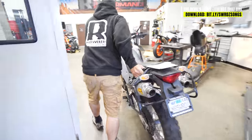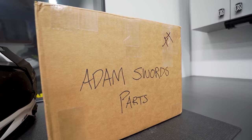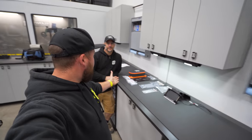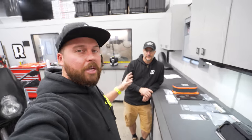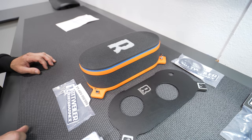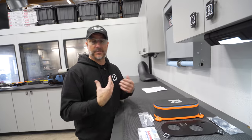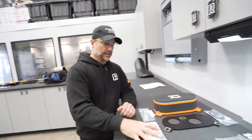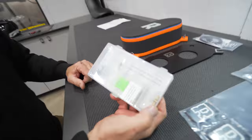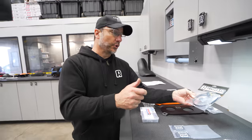It is time — we have all the stuff laid out right here that is going to go onto the bike. Chris is going to run through this to tell you exactly what it is, what it does, and why it's better than stock. Okay, super quickly, this is the intake system that we're known for — this is what really built the company right here. This will replace the stock intake system, which is horribly clogged up and lethargic and doesn't allow the bike to breathe. This allows the bike to breathe and makes it a lot easier to work on. This is the all-important jetting kit — basically a jet kit with all the right stuff in there. These are the flex jets, which allow you to adjust your fuel screw.